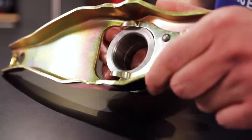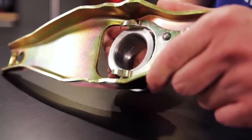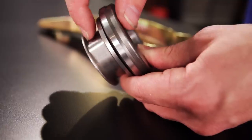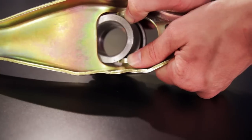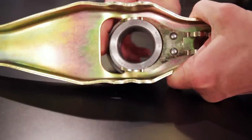Here is the wrong way to do it: sliding it underneath the tension spring. This will cost you money, and it will require you to do the job twice to make it right. To install the throwout bearing on the clutch fork properly, you'll want the teardrop here to point toward the flat side of the opening. Then from the backside, compress the tension spring fingers and slide the bearing into place.